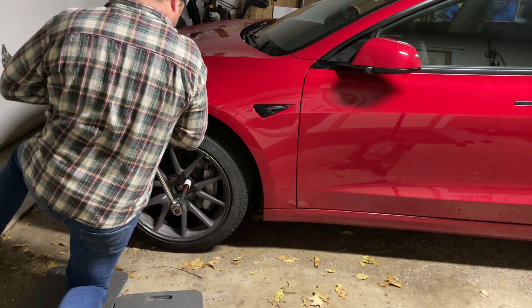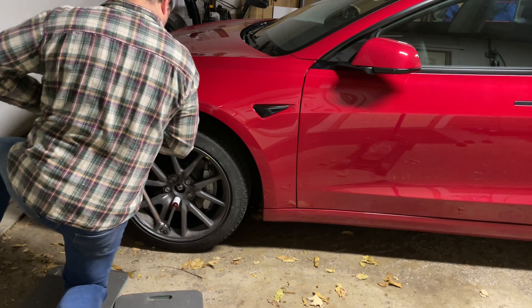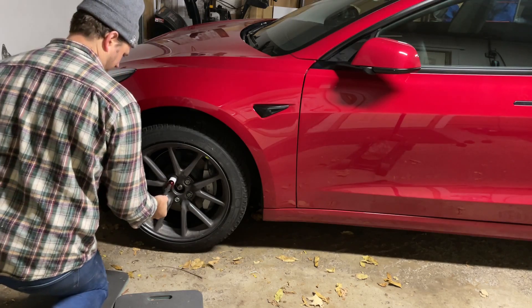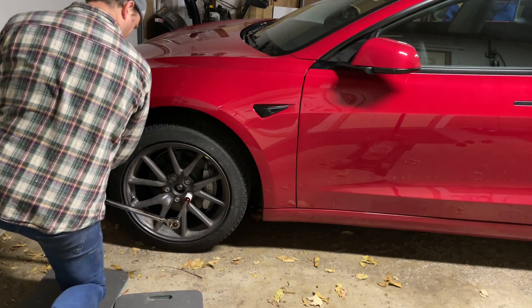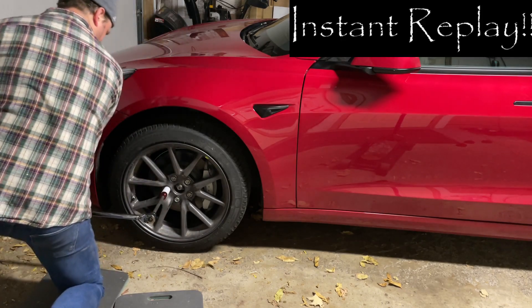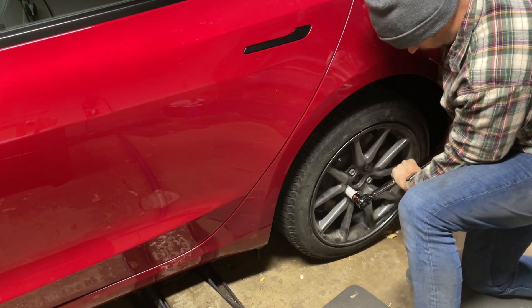Failing to follow the correct order is going to cause your car to explode. Okay, not really, but it is very, very important that you follow the same pattern you did when moderately tightening the lug nuts. I'm not exactly in the best position or form here when using the torque wrench — basically I was off to the side to help show you what it looks like, but I could have easily been on the other side too. You can get into a stronger position by having the wrench parallel on the right-hand side, so you can use more of your body weight if needed.